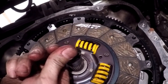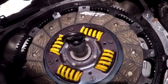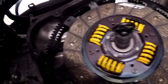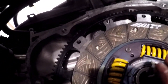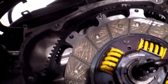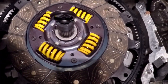So now what I've got to do is go get the pressure plate, wipe that surface down one more time, and we're going to align it on these three dowels right here. Two, hold on, not low enough, two, and then three is up here. Not touch the clutch, Jared. Going to bring the bolts down here and bolt the pressure plate on, I guess. I think that's where we're at.